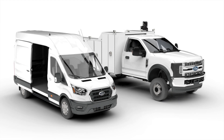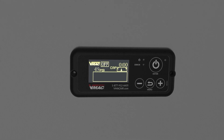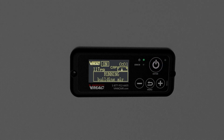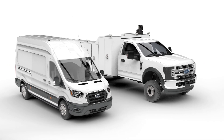Advanced digital controls are available for most 2023 and newer model year commercial work trucks and vans equipped with the Underhood 40. The OLED display box is the interface for adjusting all compressor and throttle control settings and includes the on-off function of the Underhood 40 air compressor, displaying real-time system information, service notifications, and informative diagnostic messages. The control module, or controller, continually monitors sensor health and safety interlocks for the Underhood 40 system.